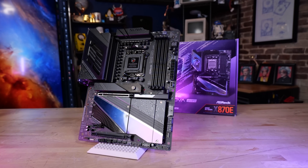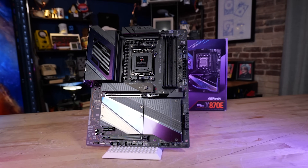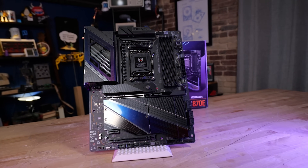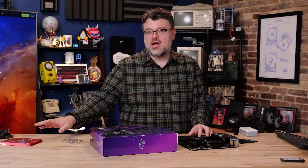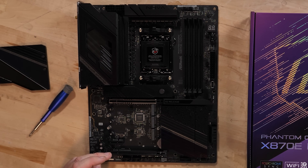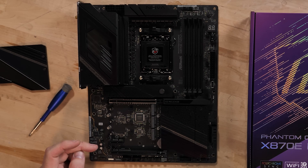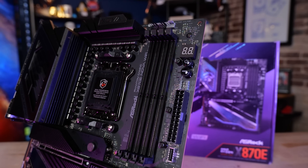This is really just a motherboard overview. My main concern is: can we get to POST reliably with DDR5 8000? That's where different motherboard models and vendors begin to differentiate themselves. ASRock's lower-cost motherboards are really optimized for maximum stability at DDR5 6000, and it can be a challenge to get DDR5 8000 to work. Our PCIe slot layout has a Gen 5 x16, plus a physical x16 slot at the bottom that's PCIe Gen 4. The three M.2 slots are all four-lane Gen 4.